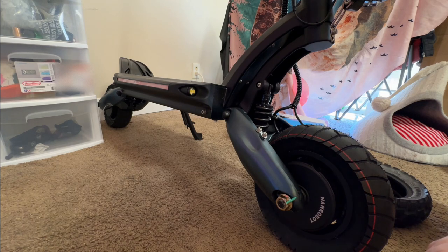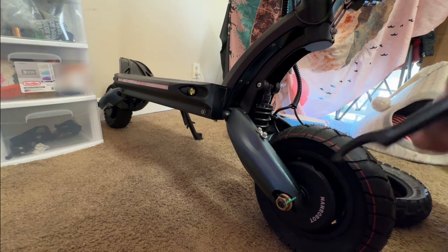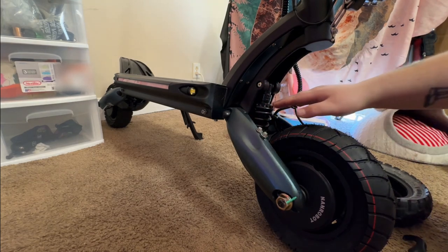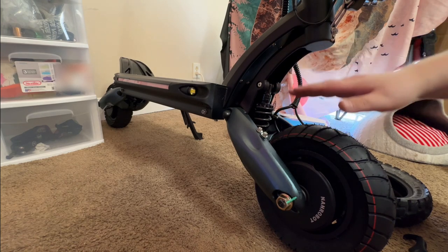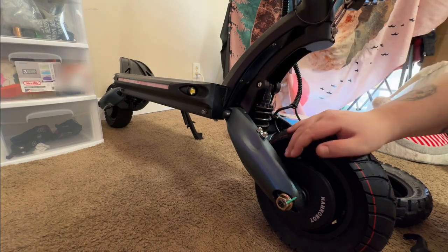Now to adjust your suspension, this is super easy. This is going to take you 2 seconds to understand. Your spanner wrench, or whatever this thing's called, 55, 62 is what it says on there. Put her on there. Lefty-loosey, righty-tighty. So that means the tighter you get this down, the more preload it's going to have, so the less trampoline-y it's going to feel. The less preload you have on here, so the looser it is, the more trampoline-y it's going to feel.